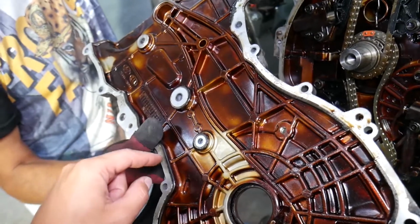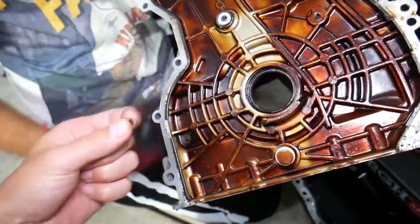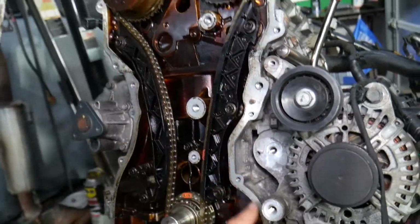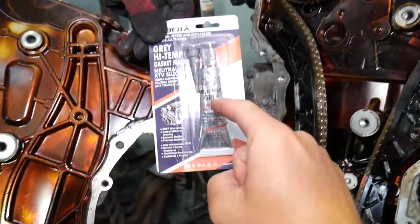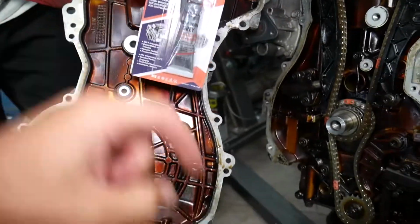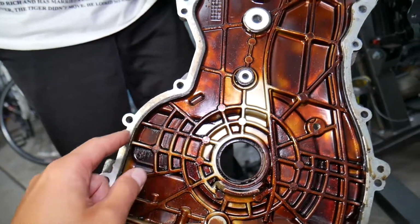Now that timing cover, you will need to clean the silicone really good. That old silicone needs to just come out, clean it, clean the engine block, the cylinder head here, use rubbing alcohol to make sure that it's not greasy, and later you will need to use a high temp gasket maker, which we'll put the link in the description of the video below, and you will need to apply on the inner side of the bolts, guys, okay, a thin bead.